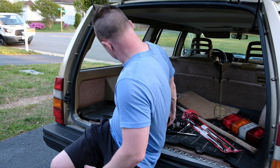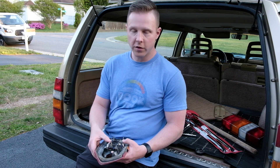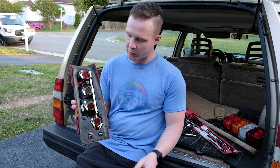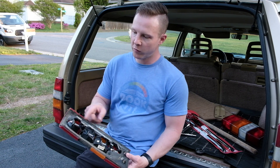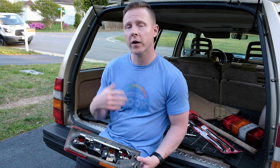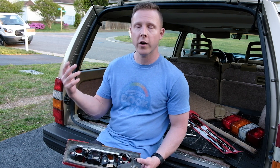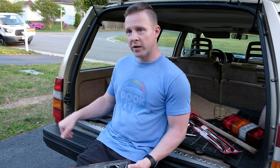One of the things I ran into was a slight difference between the two tail lights. The one I took off has a terminal down here on the bottom — I think it's a ground strap that connects to a bunch of bulbs at once. The tail light I put on is from a different year 740 and it has the same terminal but up high, so that threw me for a loop. I also had a couple of connectors that came loose from their wire, so I had to fix that. I lost track of which wires go where, got all turned around, ran out of sunlight, and had to stop. I got the wiring diagram out of the shop manual, got everything lined up correctly, and it is now in place and tested.